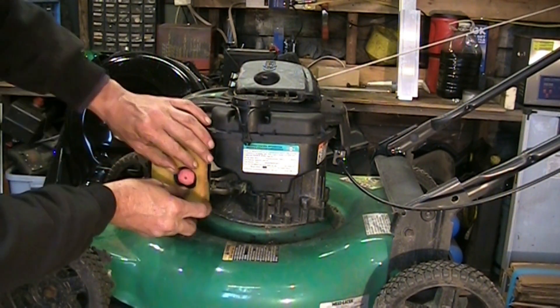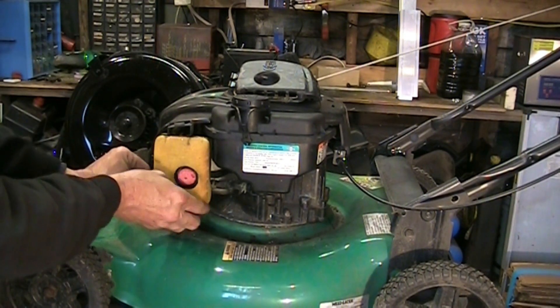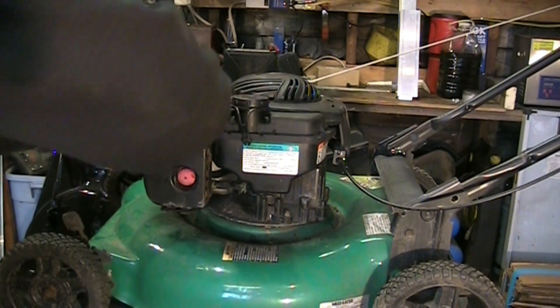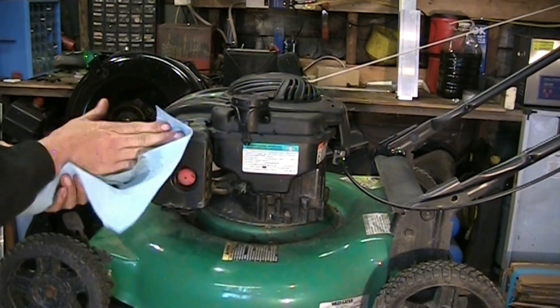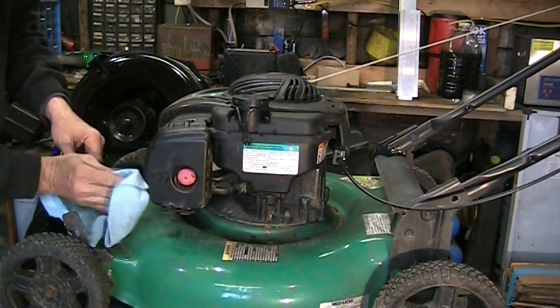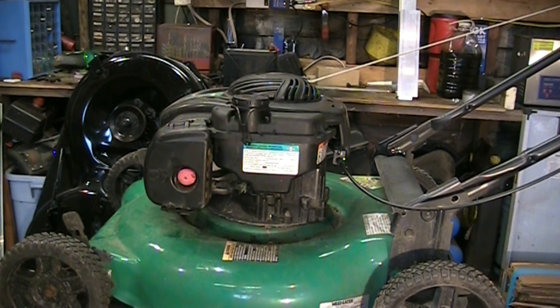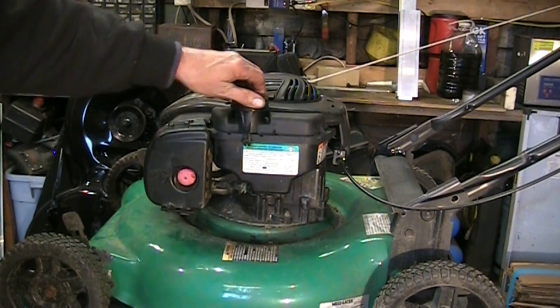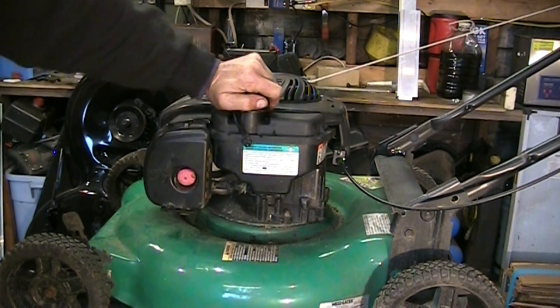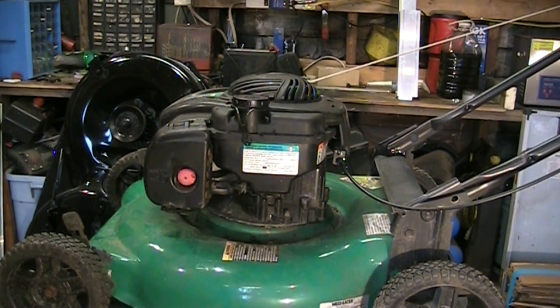In she goes - look at that, rebuilt air filter. Rebuilt, refurbished. Customers don't like fingerprints, gotta keep it looking neat when you're done with it. Now we're going to put some petrol in there - some 91 octane no-ethanol fuel with Seafoam already mixed in, because that's how I keep my gas. Fuel here is always treated with Seafoam and it's all 91 non-ethanol. If you're Canadian, the only place I know of around here is Canadian Tire 91 octane and Shell stations - most stations' 91 octane is ethanol free.